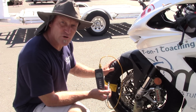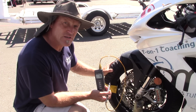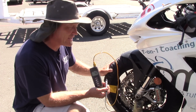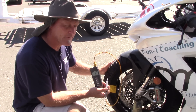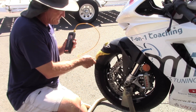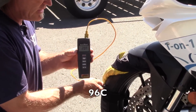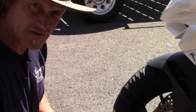When we first bought the Moto D warmers, we did the tire temperature test — it was exactly as advertised. These are two years old, and I'm at the track all the time using these — 150 days a year, these go on and are used every day. After 30 minutes on high with the Bridgestones, we're getting 202 and 206°F. So after two years and a few hundred track days, the front warmer is doing exactly as advertised.